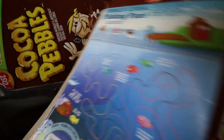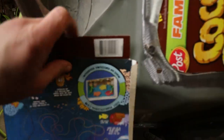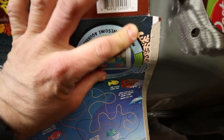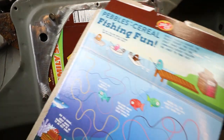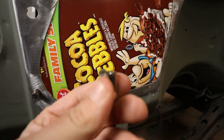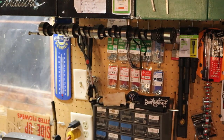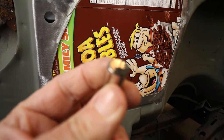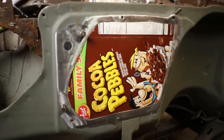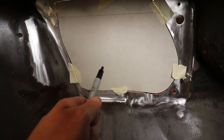What I like to do is save cereal boxes because they honestly make the best template material — it's thin, it's very pliable, you can put really nice bends into it. So I took a box, put it against here, and held it down with these Eastwood stitch magnets — they are freaking amazing, I've actually held up a camshaft to my cabinets with two of these. There will be a link for these in the description. Then I came to this side with my trusty Sharpie and traced all the way around. So we've got our template made and now we're gonna transfer it onto some sheet metal.